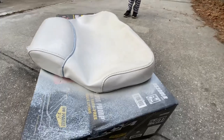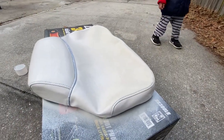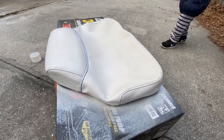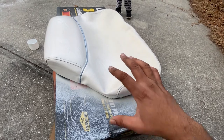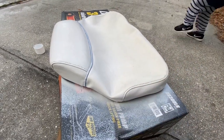I can see a little bit of liquid on the surface — it's not quite bonding well and that kind of scares me. I'm wondering if I haven't prepped the surface properly or didn't let the grease and wax remover enough time to dry, but we'll give it a shot and see what it comes out as. I'm going to let this dry, do another coat, then flip it up and prop it and do the top parts.